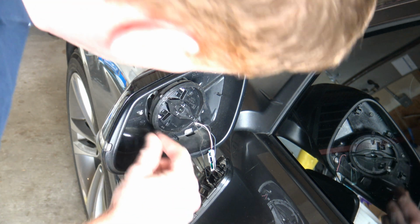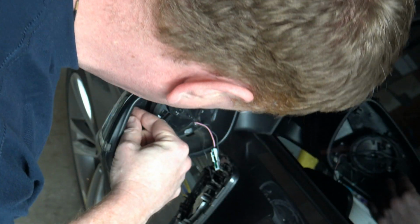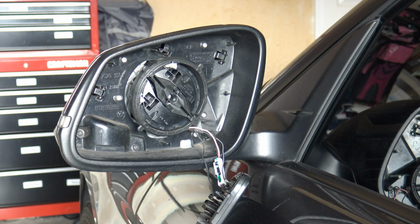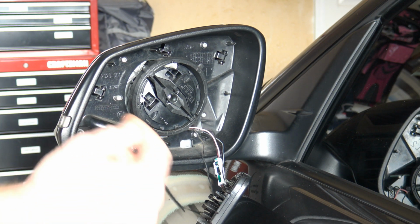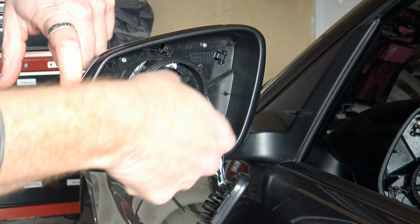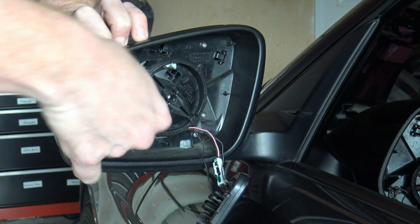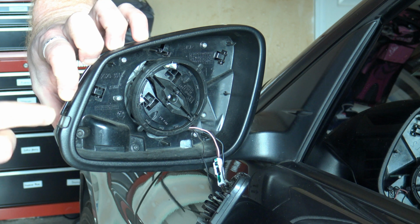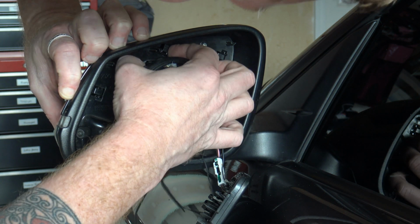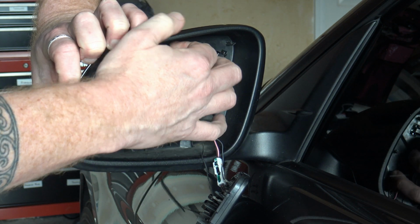There's these little pressure clips on the inside that you're going to see on the inside of your mirror as you go through here, and we're going to press those in. So I'm going to adjust a little bit, so you can see them a little bit closer. The cover has just these little clips that just push through. So we're going to apply a little bit of outer pressure right here to pry back on it. And there's one little set right here on this outer edge, so we'll press those. And again, I already feel them fall back just a little bit. The cover gapped a little bit here with my fingers. So I'm going to reach in, get the middle ones. There, and there, and I'm going to get my fingers on each side.